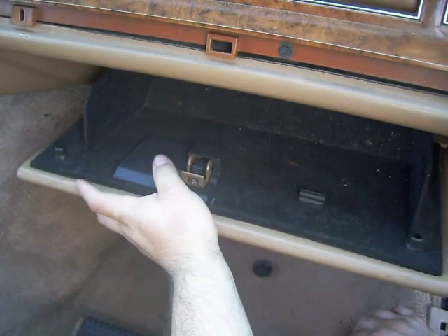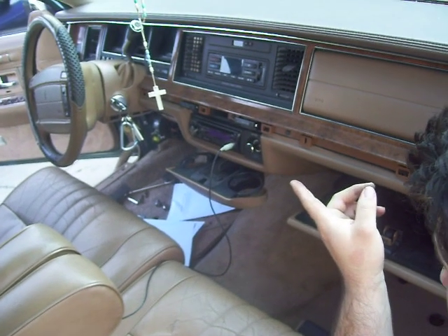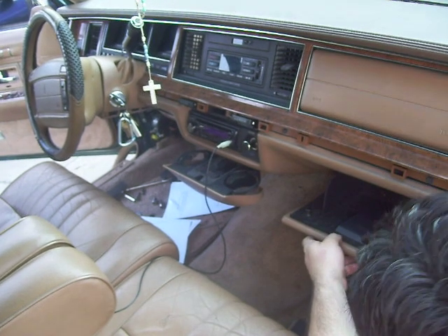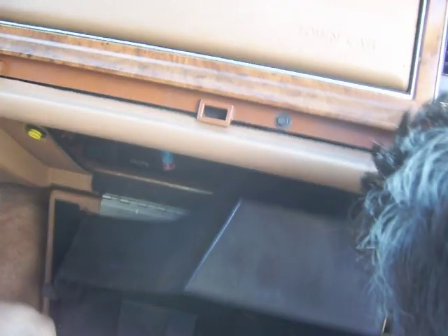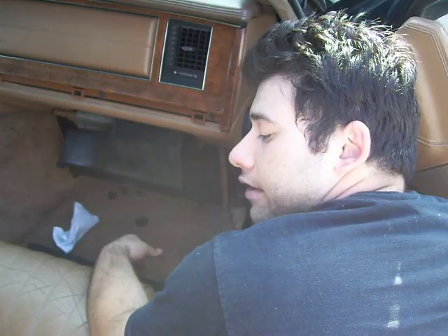I'm going to do another video where I'm going to continue to go further into taking this dash down. Also on the steering column, the plastic that goes around your key switch and your shifter all needs to come off — there are three screws on the bottom that get it off. I didn't take the plastic off yet, but I got the screws underneath, so while you're down there, take those off too. My next step is that when you take your glove compartment, there are two little things that hold this in — push them in and you should be able to get to the bolts underneath, which we're going to need to take this dash down. Thanks a lot guys — I'm going to probably make at least three or four videos of each step. I hope this will help someone else out. Good luck.